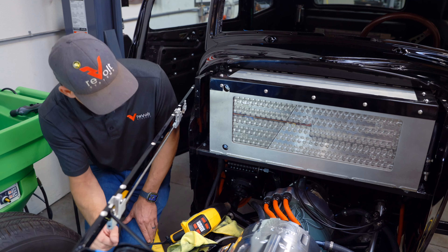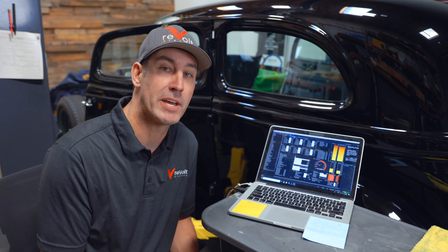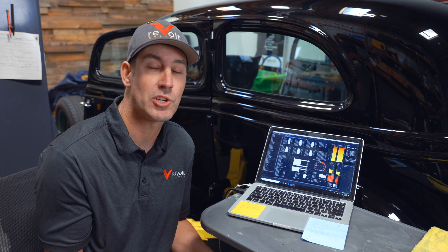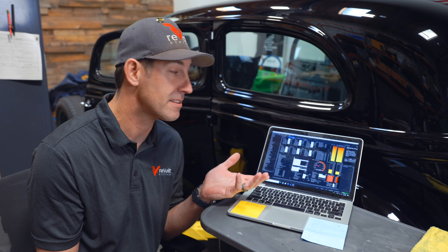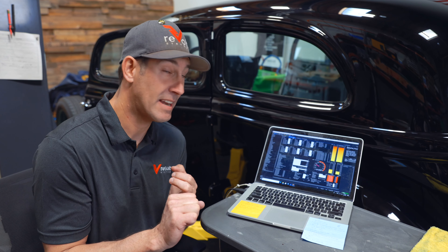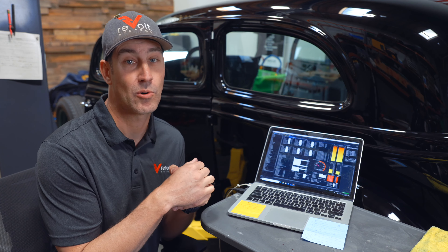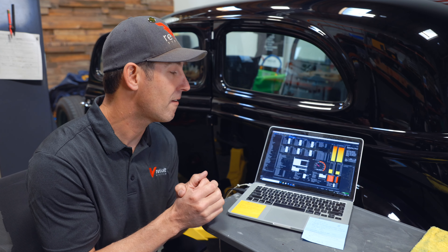We just turned on some heat for the pumps and the thermal management system for the batteries. I'm looking at my computer right now — all 16 modules started at 16 degrees Celsius, and now I can see they're all at 17, with a couple jumping up to 18 degrees Celsius. That's showing me everything is coming up gradually together — I don't have one or two sitting back at 16. This is proving that our cooling system and thermal management system is working correctly. Software like AEM Cal lets us monitor it all, and in a quick glance within five minutes of pre-warming the system we can see everything's operating the way we designed it.